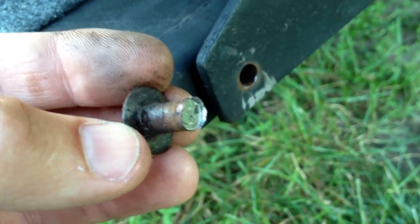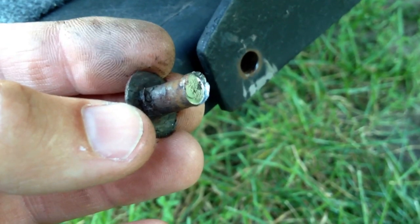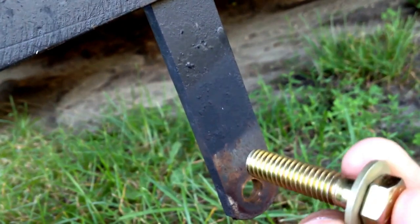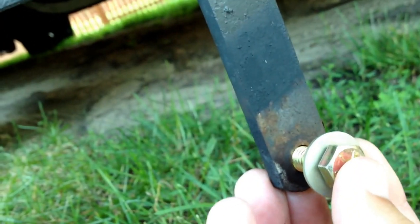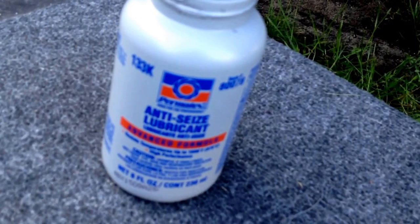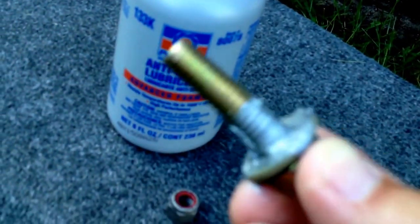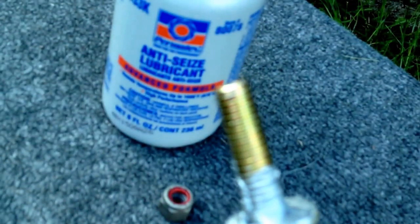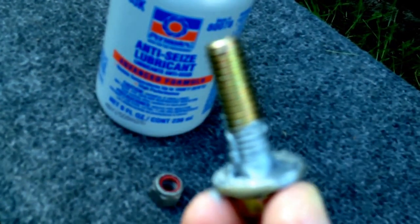So now I can drill it a little bit with the 3/8ths drill and get the new bolt in there. You'll notice a 3/8ths inch bolt fits through this hole because that was a wider part of that bushing, but it will not fit through up here. So we'll get the 3/8ths inch metal drill bit and just drill that hole out real quick. Put some anti-seize on this — good stuff just to lubricate it. In my experience this has been very corrosion resistant and resists the weather pretty well.